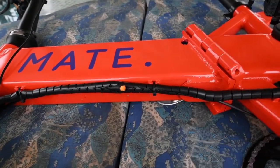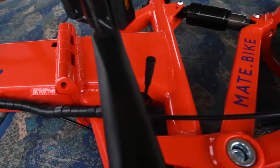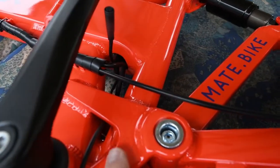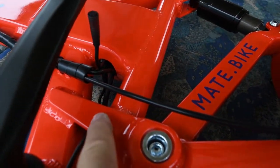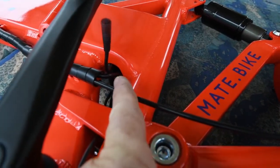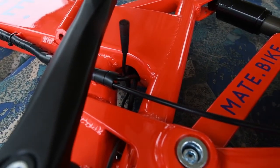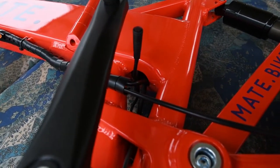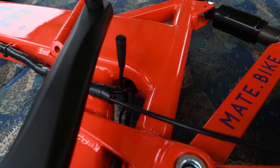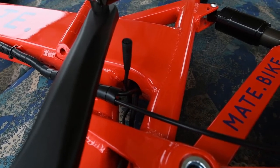so that you can add the new harness to the existing wires. Now, the one that I found most difficult was this guy. They either stuff it down here in this place, which is great if they do. If they don't, they stuff it back up in the hole, and it may be difficult to pull out. The tool that I found worked great for getting this out of the hole was a coat hanger with a little hook in the end of it so that I could hook the wire and pull it out.